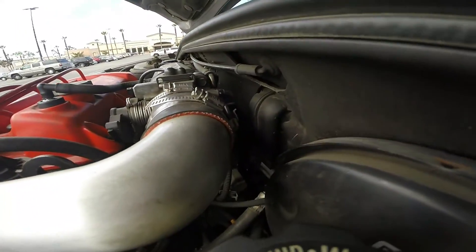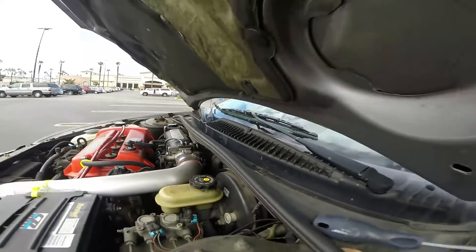What this means is that we've isolated — without using a DVOM — that the throttle position sensor is where the problem is coming from with the intermittent high idle. I was tapping on the neck of the throttle position sensor and on the actual connector of the throttle position sensor as well.